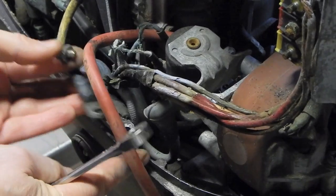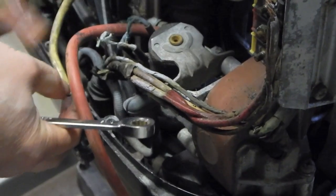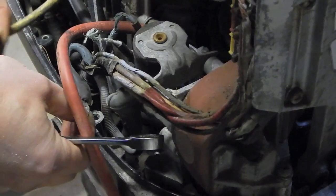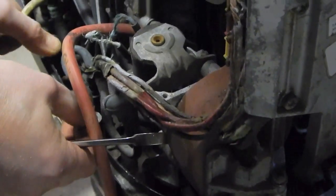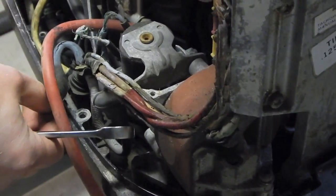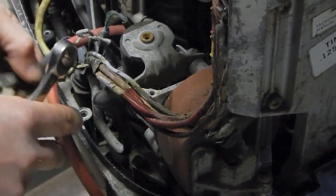And you've got this one, and then underneath it you've got this one, which actually comes in from the plug, from the receptacle here. So this is where the negative battery cable comes in and grounds to the motor, and then it's grounded to the actual engine block via this cable. So they're basically using the cases and the block itself for a ground path.